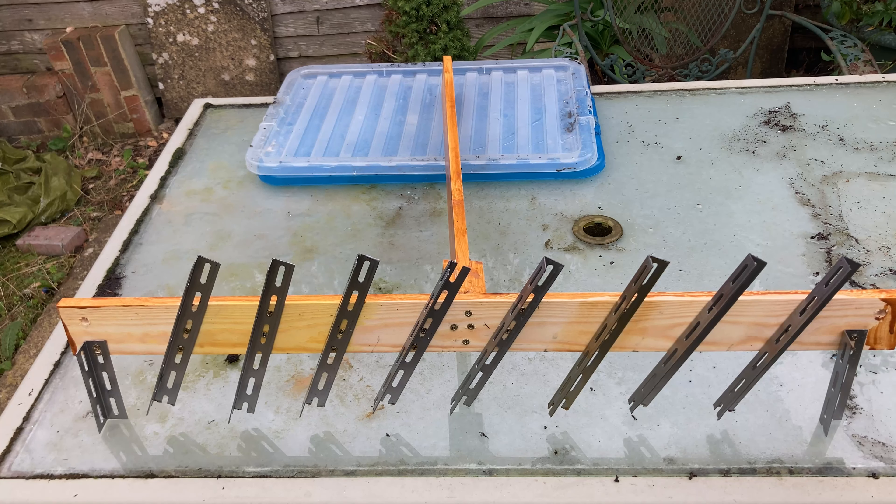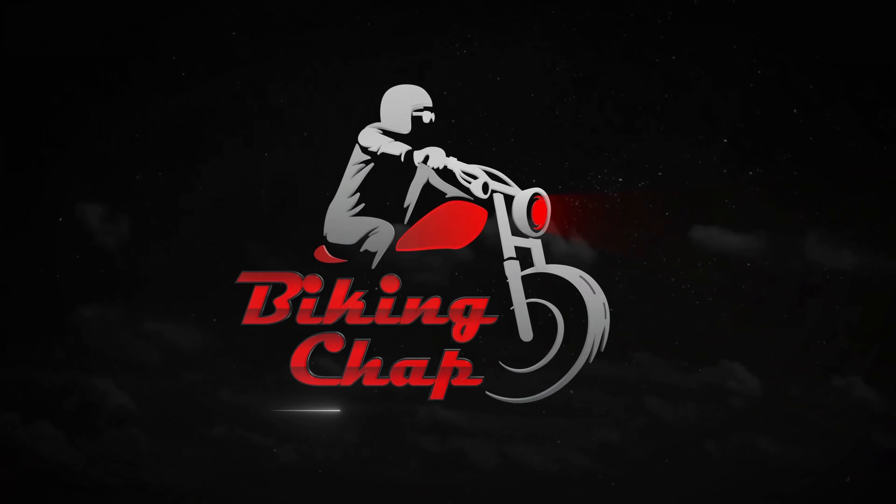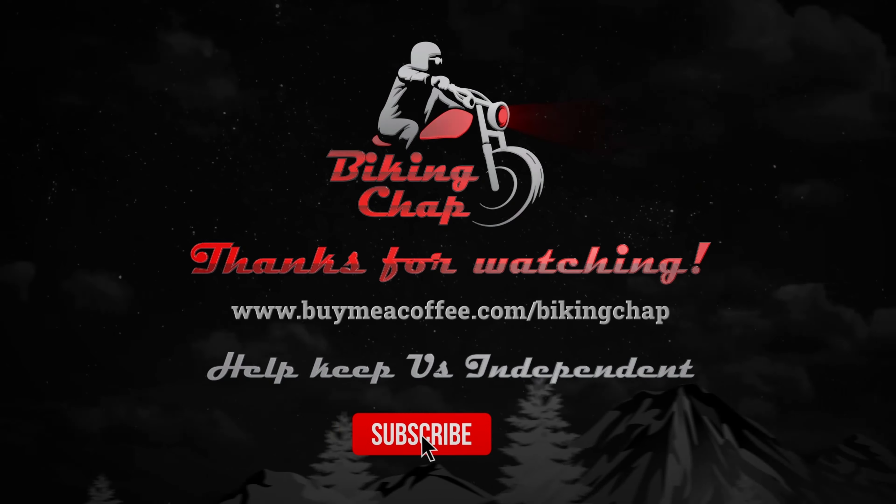The untreated outriggers serve not only as legs to keep the samples off the deck, but also as control samples to show how quickly steel rusts with no protection at all. One would hope they rust quite quickly. That's it for today — this is Day 1, September 17th. There's salt spray coming all over this from the coast, which is only about half a mile away. If corrosion comes in quickly I'll do weekly updates; if it progresses slowly, monthly. Subscribe if you'd like to follow along, and let me know about the FS365 — should I reapply weekly, monthly, or just let it run? Thanks for watching, cheers for now!